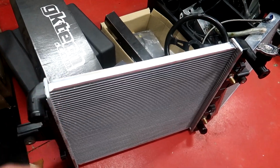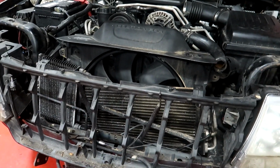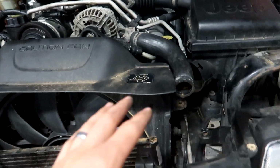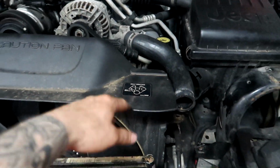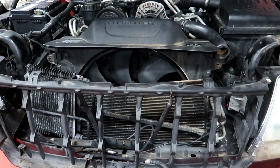So yeah, it does the trick, because if you're doing anything aftermarket, you try and recreate that. So a good shroud and good fans will do the trick. A lot of people get overheating issues when they run eBay fans. They just can't pull, and there's no shroud at all. The shroud is like everything. It just funnels the air through and uses your whole radiator. So yeah, let's have a go at putting this in.